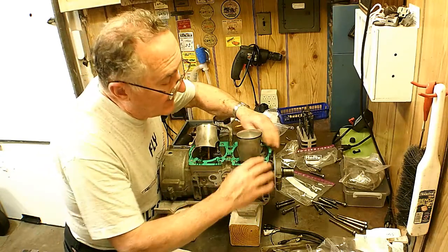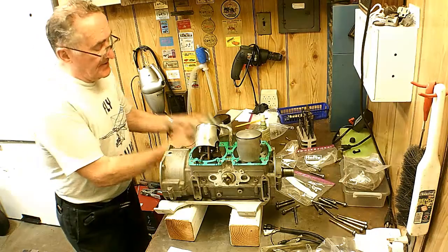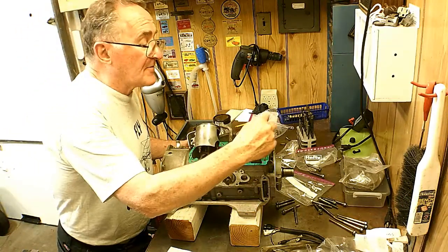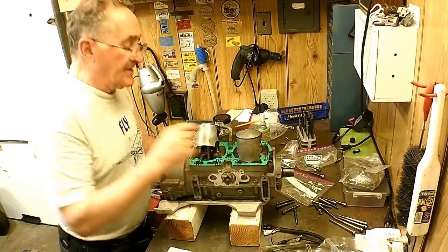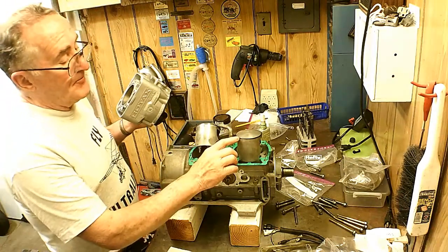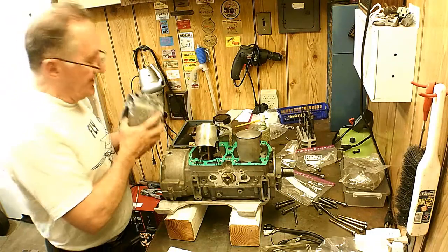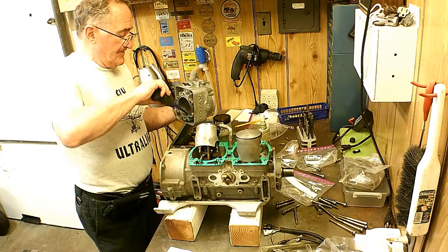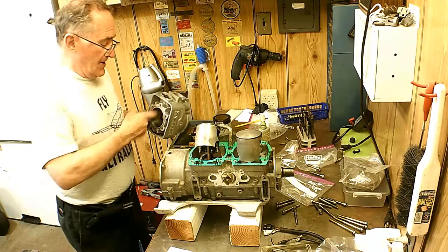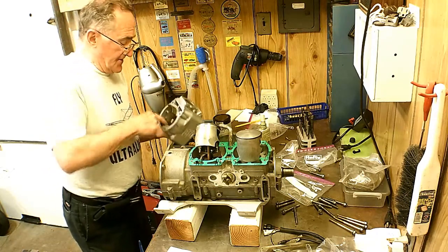There we go — now we got it on there, and the oil kind of makes it stick too, and hopefully it'll make it stay in place a little bit until I get the cylinder on. Because I honed it a little bit just to break the glaze in there, I kept the same piston in the same cylinder. They're marked here with a P for the PTO end and an M for the mag end. I want to oil them up — it's the same piston ring on the same piston, same face up. I don't change anything about it because those parts are worn together.